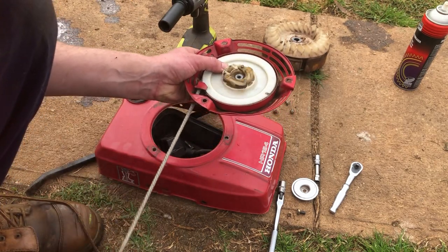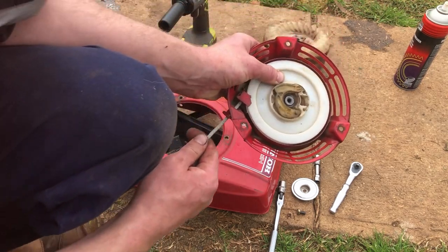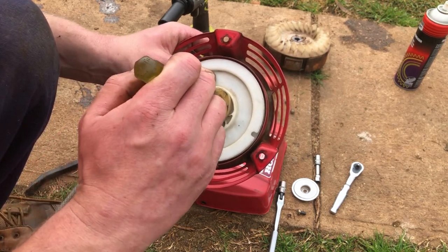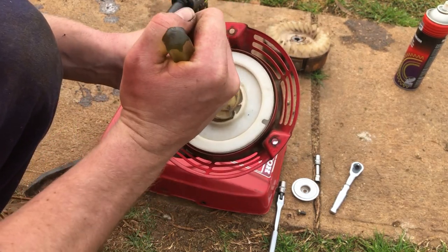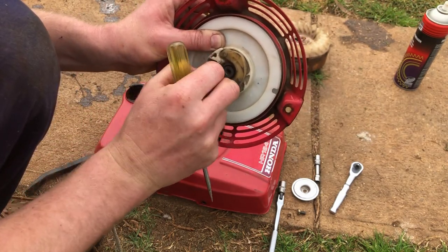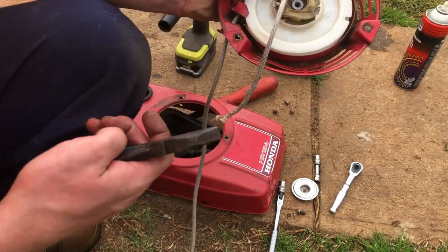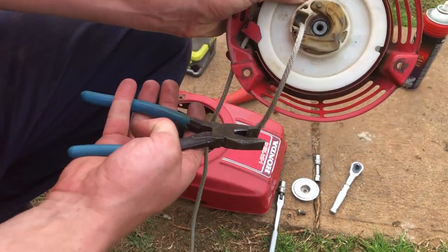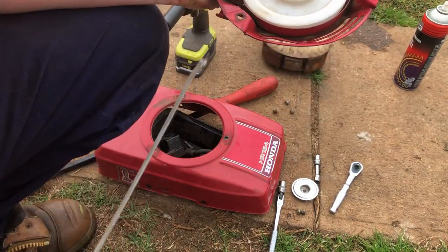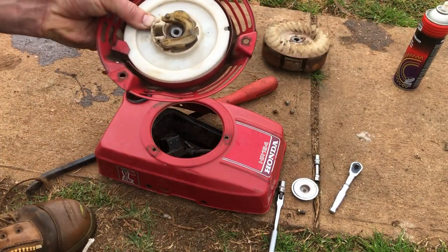So we'll want to wind the rope all the way out, but make sure you can see it. Keep pressure against the starter pulley. Come on, you old prick. Pull the old rope through. Now, I'll grab some pliers. I think I've picked my bluntest pair of pliers I got, but we'll see how we go. There we go. Now, tricky part will be feeding this new rope through